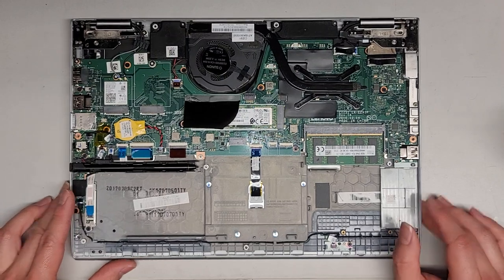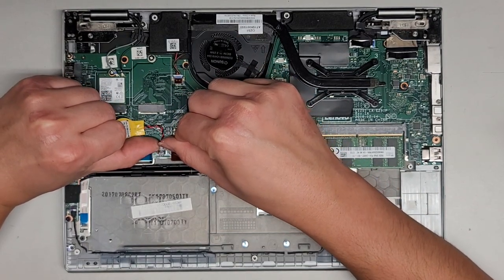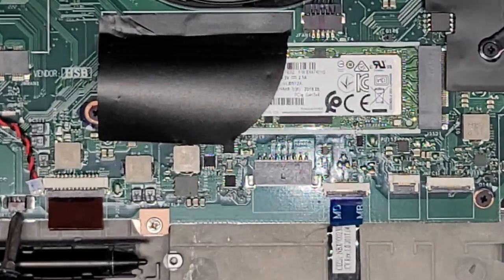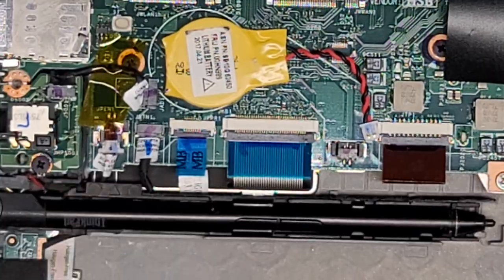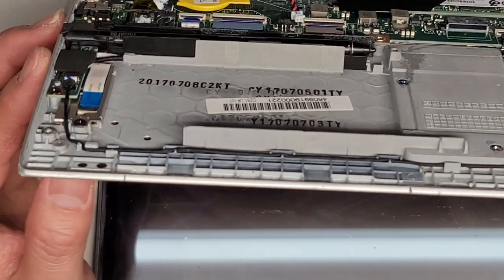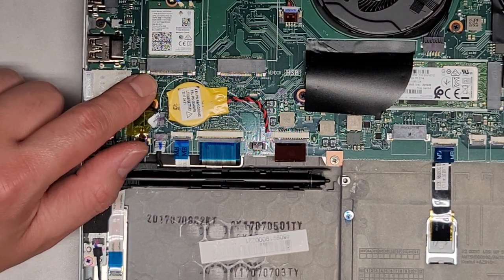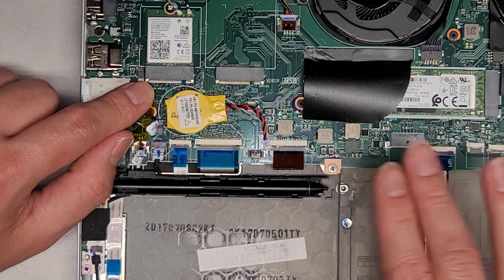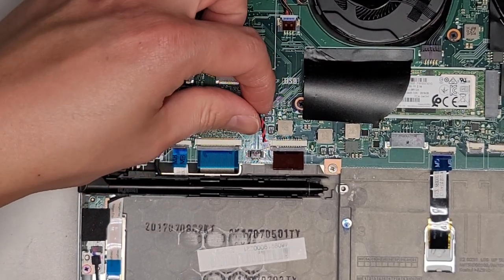The other thing I did when it wasn't turning on was a CMOS BIOS reset. I pulled this CMOS BIOS cable out — just wiggle it with your thumbs or fingernails. After you do that, get something metal and just short these two pins together to drain the power between the two. On top of that, you can open the laptop and press and hold the power button for at least 15 seconds. You can also press that battery reset button through the case for about 15 seconds. I would also disconnect the battery to do that. Usually you don't need to remove the main battery to reset the BIOS.